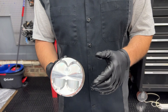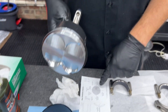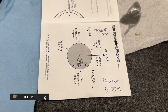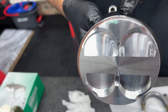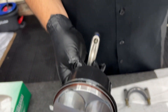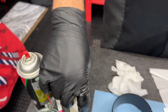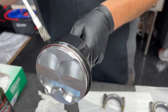Today we're going to get those pistons into bank one. On every single piston we want to check the indexing we talked about before — second ring at the top, top ring 180 degrees, no overlap on the oils, and the oil gaps where they're supposed to be. Lube everything — this came with a piston assembly lubricant from LN. Lube everything: side skirts, rings — all this has already been done.